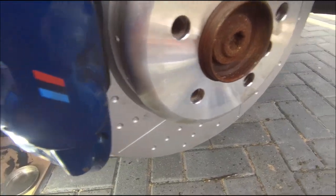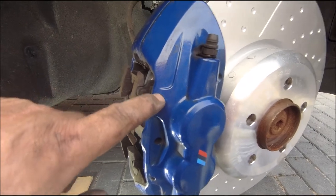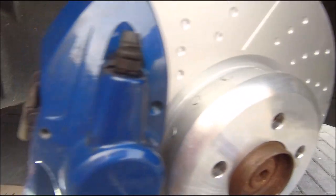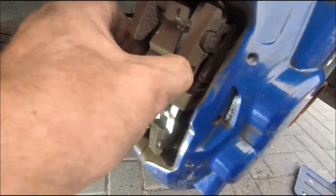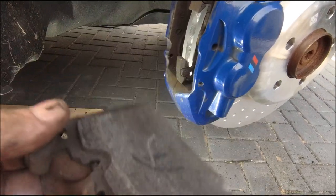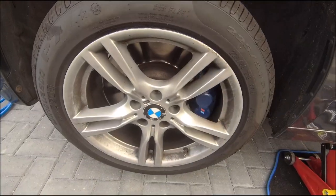I used a screw but I can't find it now because there's loads of stuff here. Anyway, take my word for it - the screw went in there, give it a little bit of a tap. Here's the screw - a little tap in there and then the pins, which are here. They just slide out like that, and then in theory your brake pads come straight out. There's still some meat on those. Right, let's get on with it - one side complete, rinse and repeat.